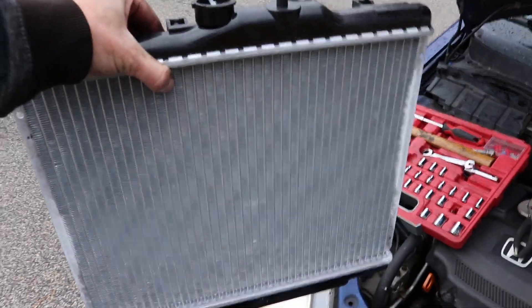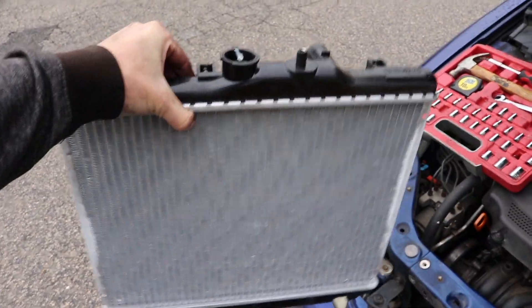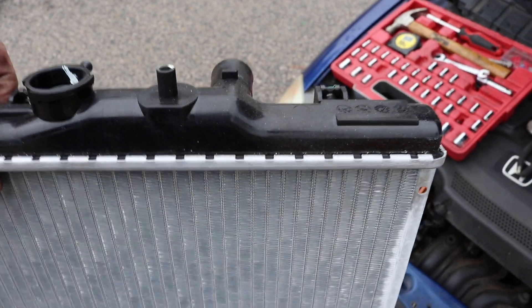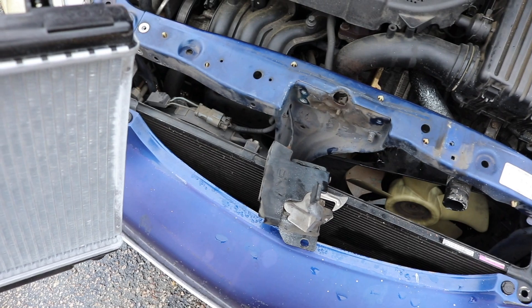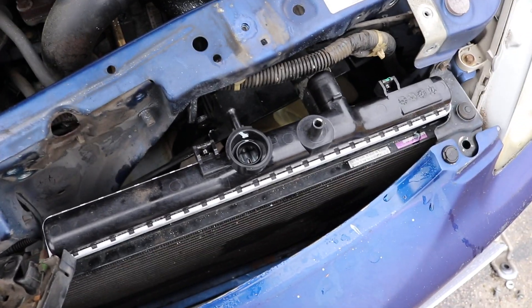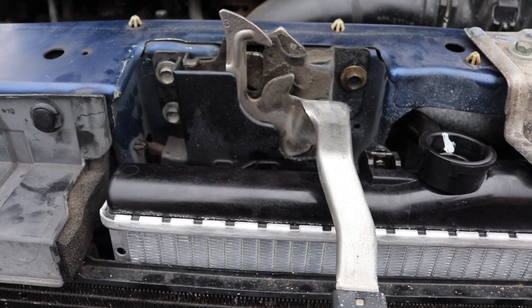Here's the new one — clean and gorgeous as it should be. Sadly I wasn't able to get this on Amazon, but I'll link below where I got it — less than 100 bucks for a brand new one. I would have liked something not plastic, but hopefully 20 years later they have better plastic. I'm going to do the reverse and pop it in without screwing up any fins. I ended up taking the front brace off completely for easier access. Also something I forgot to mention: the little rubber feet on the bottom of your old one — make sure to transfer those to the new one.